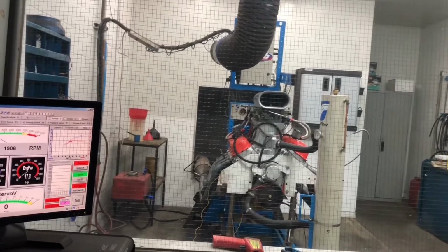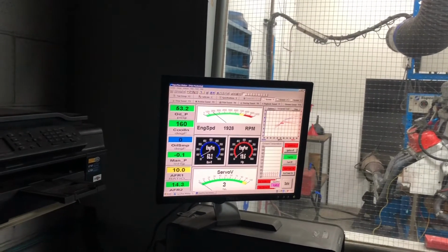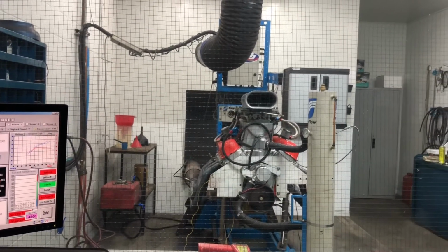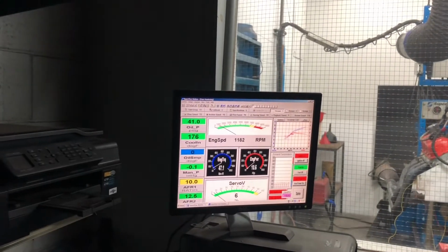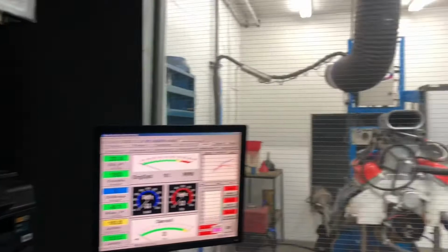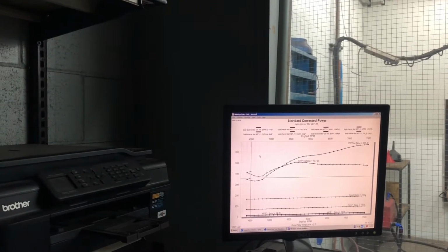And for some reason, it leaned it a little bit. Yeah. It made a little richer dip in. It did. It must make a worse signal by the booster or something. I have no idea. Very strange that it would make more horsepower. It's funny, it idles at very good AFR though. I haven't had tunnel rams do that, but when I drilled the idle circuits in those carburetors, I drilled them out a little bigger knowing that we have that problem. So it actually made more at 5,000 RPM, well, it lost a little bit that time, maybe because it's hotter.